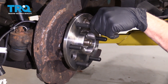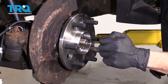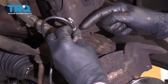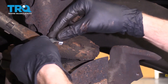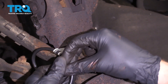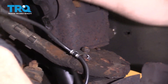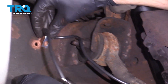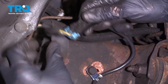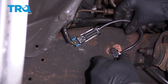Now let's torque this to 133 foot-pounds. Now let's secure our ABS wire — you're going to notice you have little prongs. Set those so they're facing down towards the control arm and ball joint. Take your bolt from the bottom to the top and start on that nut. Bring the other end all the way over, grab that ABS wire, connect it in, and push this tab into the frame. Make sure it's nice and secure.